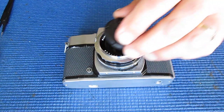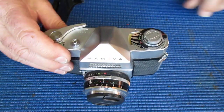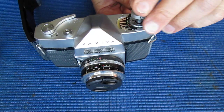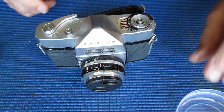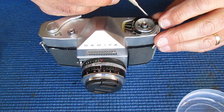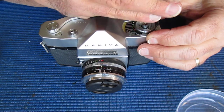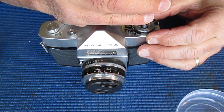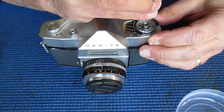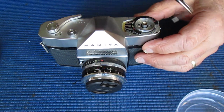I'll start with the top. Open the back and we'll remove the rewind knob, which comes off simply by unscrewing it. Underneath the rewind knob there are three screws holding the meter dials on the top. There's also a single screw here that holds the top cover on — we'll see if that will come out by itself. If it does, we don't need to disturb those other three at the moment; they can be dealt with later.